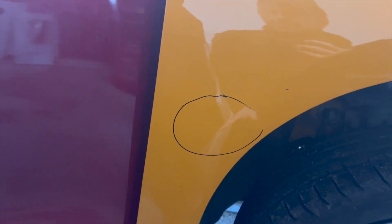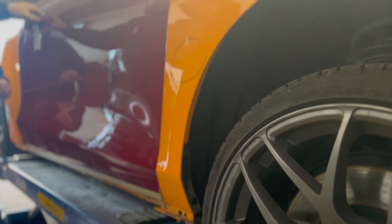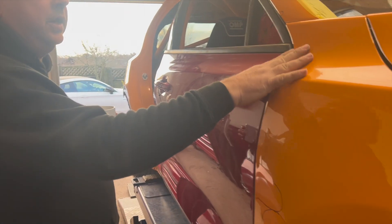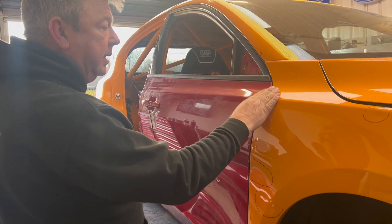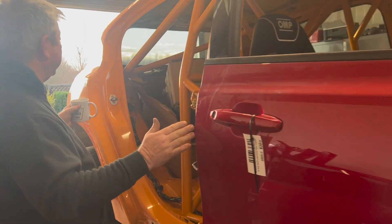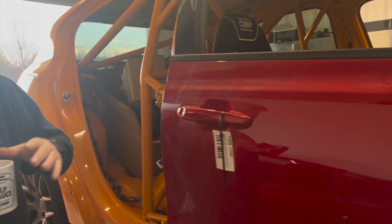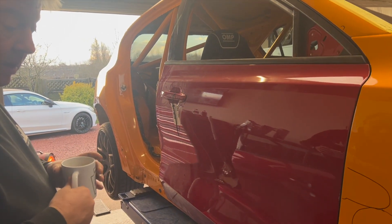The only problem we've got is this wing is repaired, so it's whether the wing is perfect shape or not — the bottom of it was twisted. You might be wondering, it's a race car, why be so pernickety about the door gaps? Well, if we get the line correct on the door with the wing, then we can work our way back, and that means we should be correct to the back. If you don't spend the time getting this bit correct, you'll have a knock-on effect further back — you'll end up chasing a gap or you'll wind up too tight.